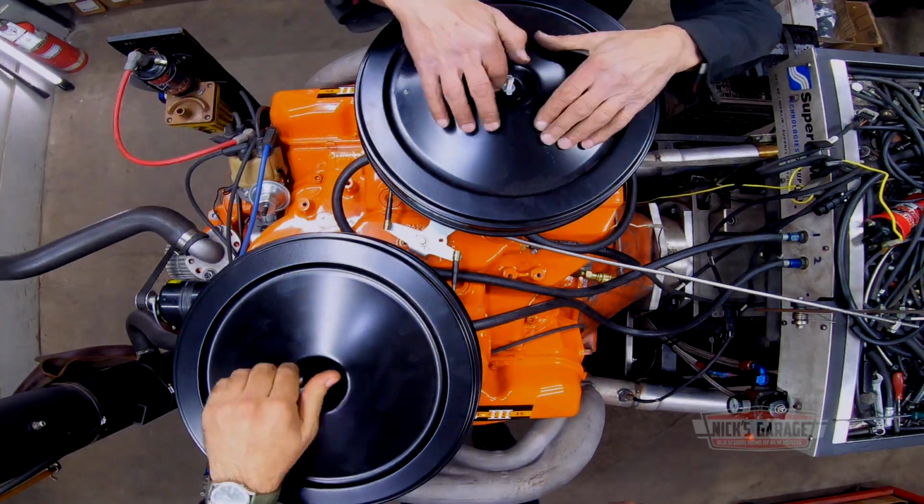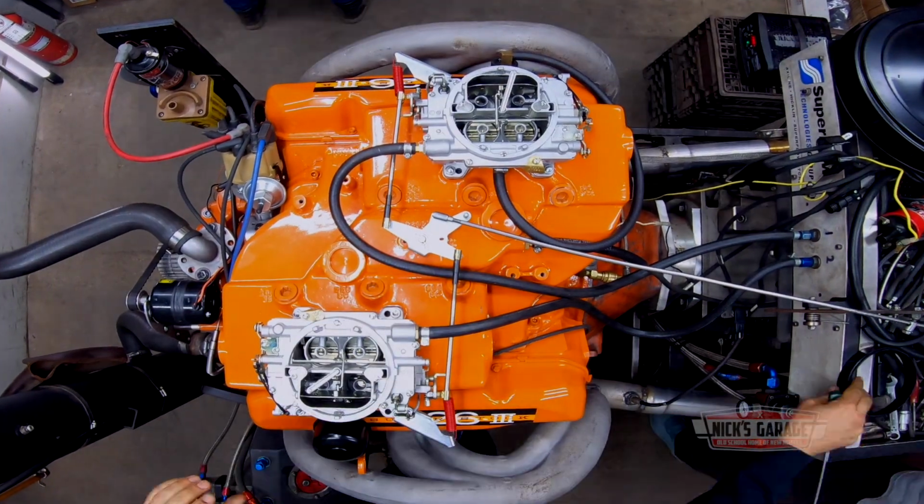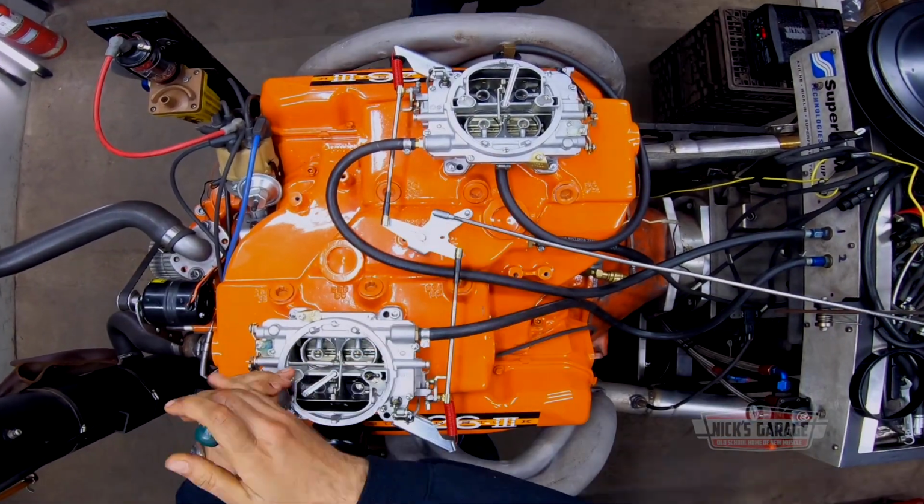We'll keep the same springs, change the rods. We're gonna put the old rods. Yeah, we're running 14.2, 13.9 air fuel ratio. That's way too lean. So now we gotta richen it out because the car's gonna run with air filters on. So we gotta put the same rods back in. Okay, let's do it. The air cleaners have made a significant difference.